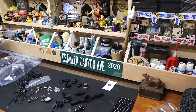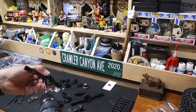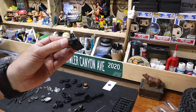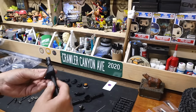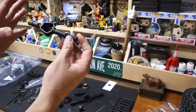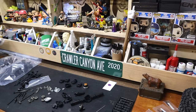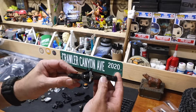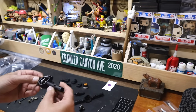We're basically building an AR-44 — it's a GA44 — but we're building an AR-44 with just that little G-Made spin on it. I love that they do the very angled design. Even though the ring gear is a little big, this is a passably sized pumpkin on a straight axle. And we should have plenty of room with this being a portal. There's only one way for that to drop in. Props where props are warranted — it does not feel at all like we need any kind of shimming.